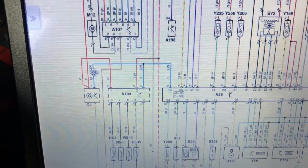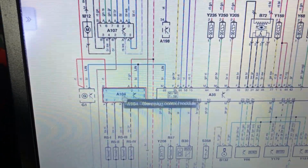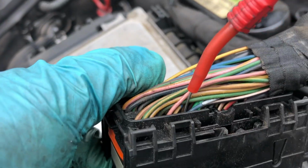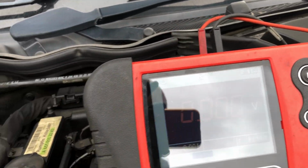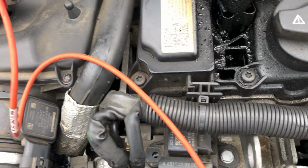So I'm going to find the wire in the harness, and we'll test to see if we've got continuity between these three components. On this plug, it's a blue wire. You see it back probed in there, the blue wire. I've identified on the glow plug control module the third one along there, which is the blue wire. So that's the zero continuity. So basically I've got a connection between the engine ECU and the glow plug control module. So that wire from there to there is good, so now I need to check the wire from each one of these components to the alternator.